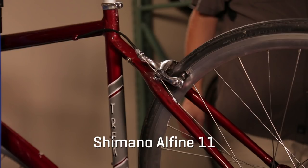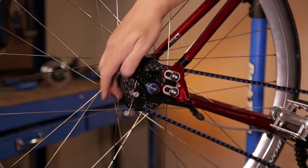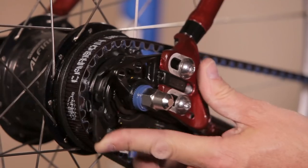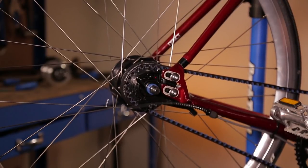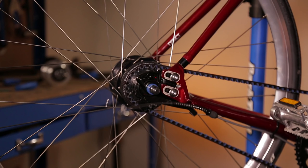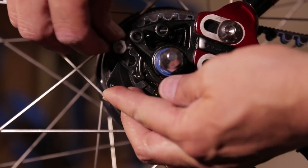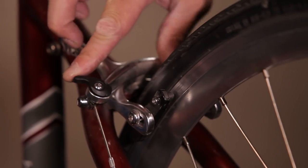Now let's look at the Alfine 11 and a caliper brake. For a caliper brake, you'll want to first loosen the brake by flipping the caliper lever. Now you can put the bike in the lowest gear and remove the cable by pulling up on the lever attached to the cable end. Reverse the order of this process to reassemble. Secure the belt on the front and rear sprockets and return the wheel with the belt in place to the dropouts. Never pedal forward to roll the belt onto the sprocket. Reconnect the hub as demonstrated earlier. Remember that the cable goes over the hub to engage the bracket. Make sure the axle is fully seated in both dropouts, the axle nuts are securely tightened, and don't forget to reset the brake by flipping the caliper lever.